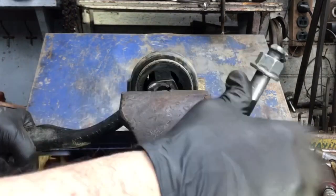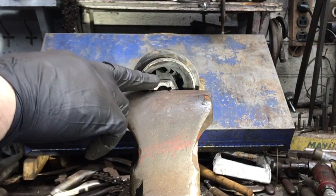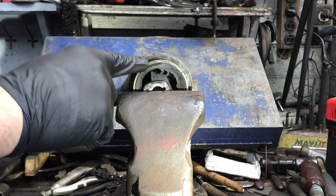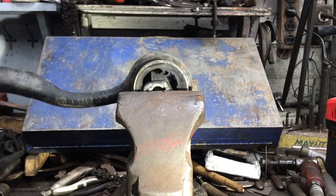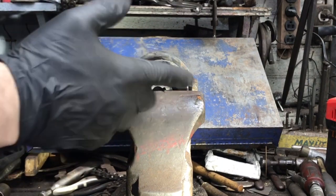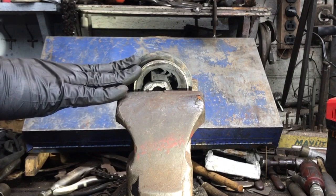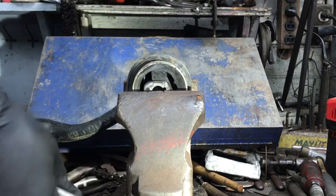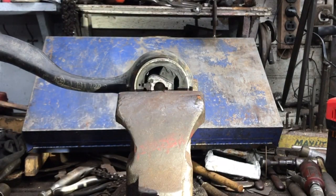So let's say you've got your car jacked up, you've installed the new part, and your suspension is just sitting there hanging. If you were to just tighten the bolt and then drop the car down, this bushing is now under all this rotational force. This bushing is actually not very old at all, but obviously the customer when they installed it didn't preload the bushing. The second you lower the car, this bushing is going to be at a crazy rate of deflection — it's not going to be where it wants to be. This is just sitting at ride height, so imagine what happens if you hit a bump or a pothole. It's not hard to imagine how fast you could tear through a bushing.